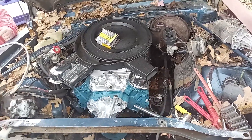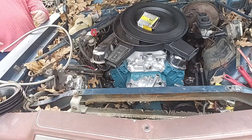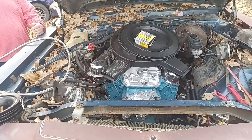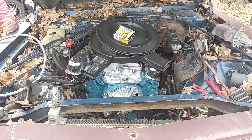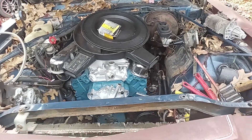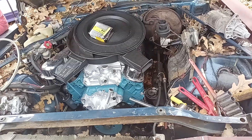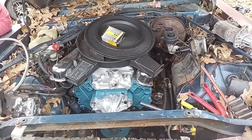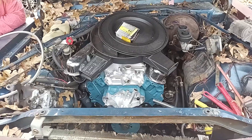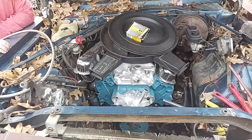Anyway, about this car — the LeBaron — I wanted to show you something that's really important. I know a lot of people run out and they go buy timing lights. I have two timing lights. Never use them. The reason is, I set my timing with a vacuum gauge and by ear.